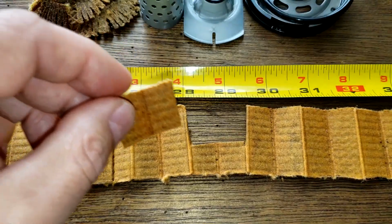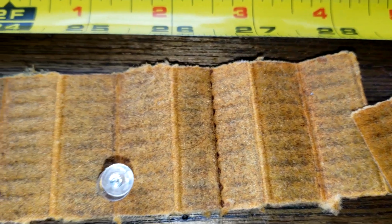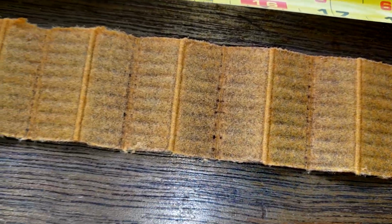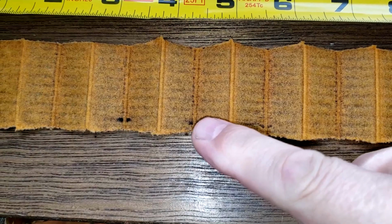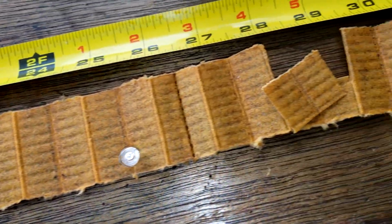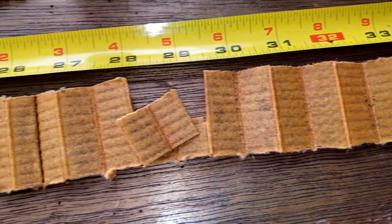So as you can see, it caught a few dirt particles there, some soot and carbon, but not much. Let's take a look at it up close. You can see the surface is really clean. There's a couple little spots like those. That's like nothing though. And there's a couple over here also. There, and there. But overall, this is a really clean filter. His engine's running really clean. Yeah, I'd say that Mazda oil is pretty good.